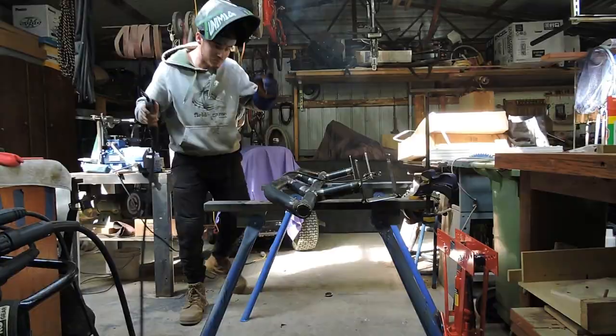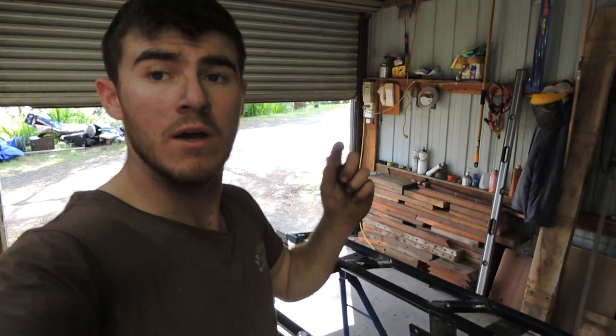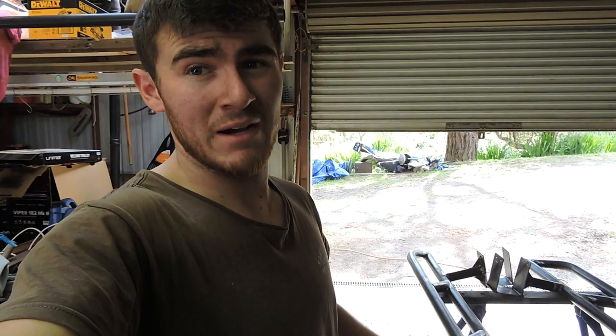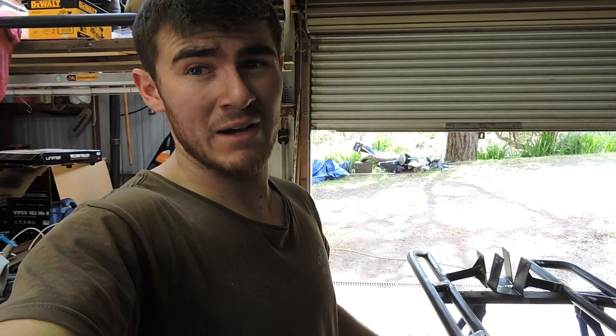I've put all the gussets in, mounted them on the car, and they both look fantastic - I'm super happy with that. I've decided not to do the rear hoop. I had some 30 mil tube bent up but I didn't like how it was going to attach to the sliders. I plan on connecting these sliders with the sliders on my tray instead - that should be good enough to cover the rear quarter. I've cut the ends off flush with the front and made some little discs to weld in the ends, then I'll start priming and painting.